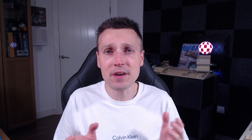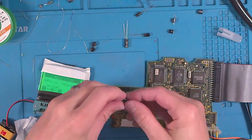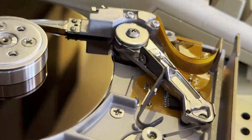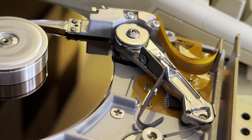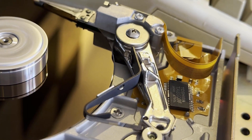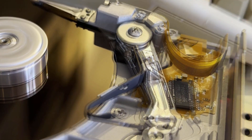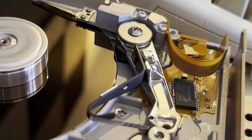There's quite a few capacitors so I won't show them all, but once removed, three of them had stopped working completely. It's interesting to see that the drive now starts all by itself, so that was at least one of the issues. Also note that the drive has no issues moving the head, and I think this is part of an initial startup to get the head into a known location. This weird behaviour keeps repeating and I'm guessing it's trying to find the first track on the drive. Most likely the heads or the disc platters are damaged beyond repair.